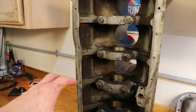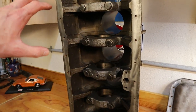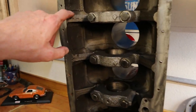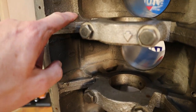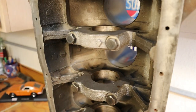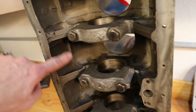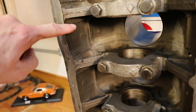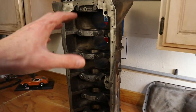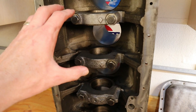So what is casting flash? These are cast iron blocks, and when they are being made they are sandwiched between layers of sand and mold. What happens is the iron tends to ooze out slightly, leaving chunks sitting inside. Those might or might not fall off, so we want to go through all of the walls, grind them down slightly, and remove all this roughness. This also allows the oil to slough off and not stick to the walls of the block.